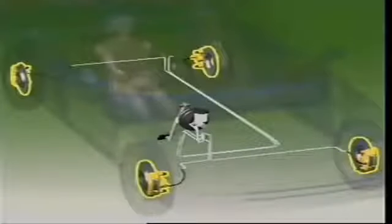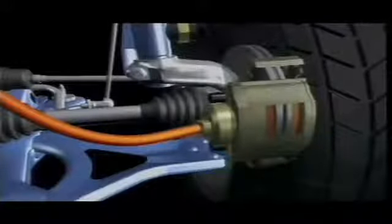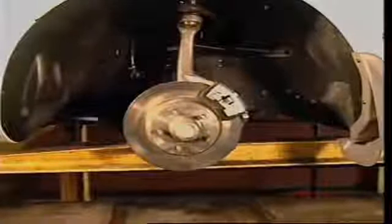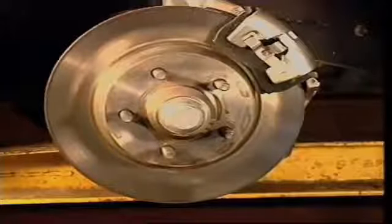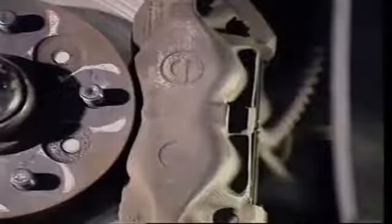The pistons operate on friction pads to provide a clamping force on a rotating flat disc that is attached to the wheel hub. This clamping tries to stop the rotation of the disc and the wheel. On non-driving wheels, the centre of the brake disc or hub contains the wheel bearings. The hub can be part of the brake disc, or a separate assembly between the wheel and hub with nuts or bolts.